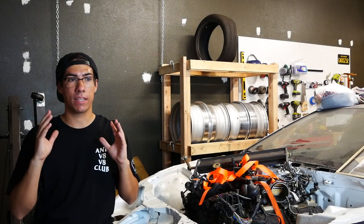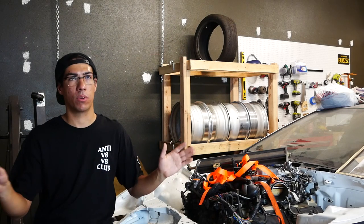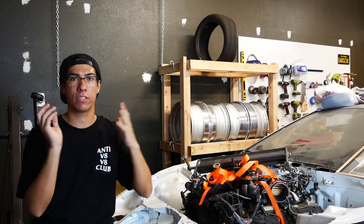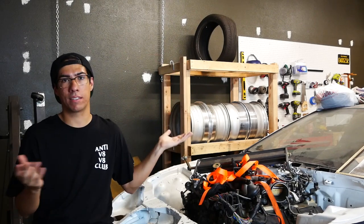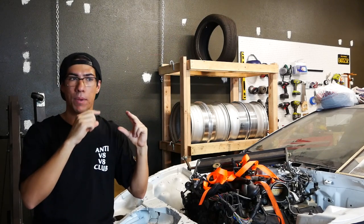The reason there was an issue is because I looked at other motor mounts when making these ones. Performance VH is the only one that really sells conversion kits. They say you can use the stock transmount — just flip it 180 degrees so it pushes the engine back. I didn't flip it 180 degrees because that has nothing to do with the engine being level. So I kept that mount and just replaced it with a hockey puck, but it sat at the same height.